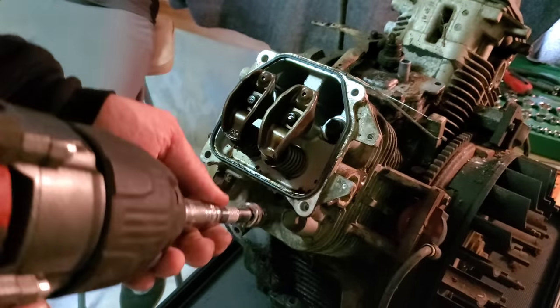So at this point, sand and make it flat and scrape off gasket remains, clean it all up once more, replace this, same to the heads, and then start throwing it together. All right, so a blue Scotch-Brite pad, and just take your time going across and don't gouge into it, float it across. That's the big thing. Make sure you're not grinding down in, you're just floating.